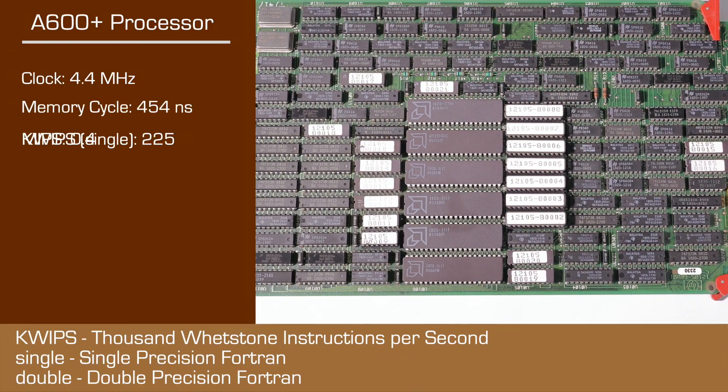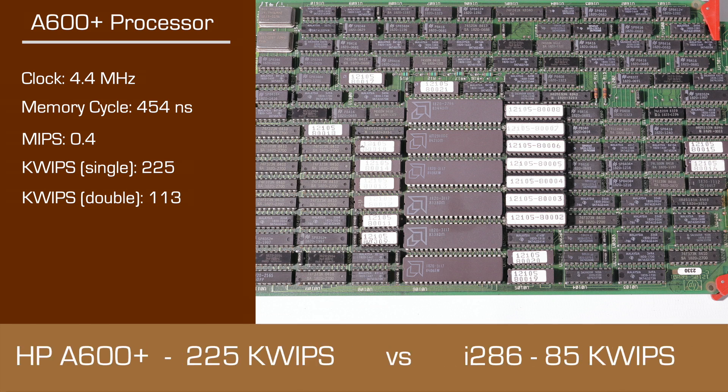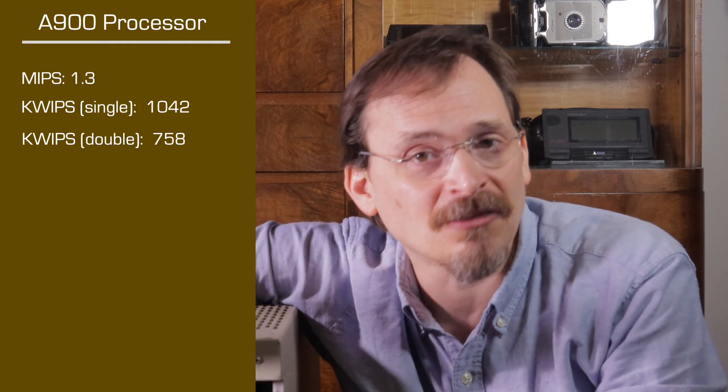Here's a closer look at the CPU itself. The system clock is about 4.4 megahertz. If you look at the contemporary Whetstone benchmarks, it's more than twice as fast as the Intel 286. It had native floating point processing for a start, but in comparison to the 32-bit 386, it's a fraction of the performance. Later processor iterations on this platform jacked up the speed by a factor of 7 before the end of the series in about 1991.